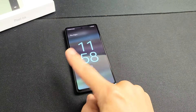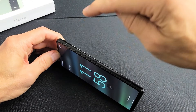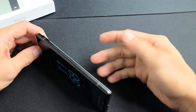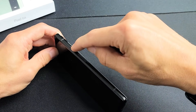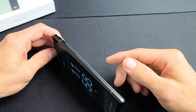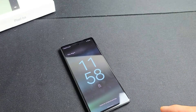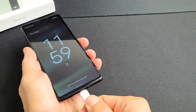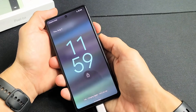You're still stuck in a boot loop — no problem. For step two, hold the phone and press the power button in and out three times. Don't do it five times, because if you have Emergency SOS set up, pressing the power button five times fast will call an emergency line. Just three times, pressing kind of hard — one, two, three — just in case it's jammed or stuck, since a stuck power button can cause a boot loop. Next, go ahead and plug it in, give it a charge, and let it sit for about five seconds.